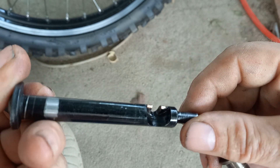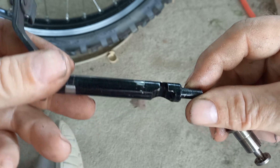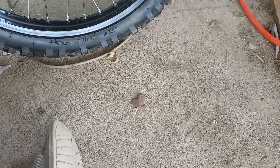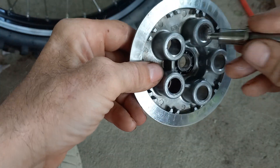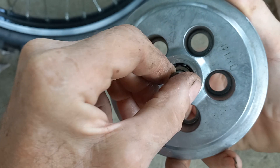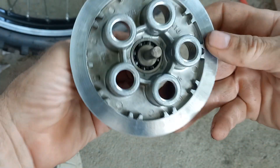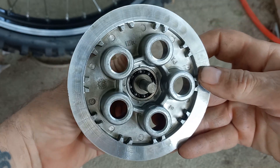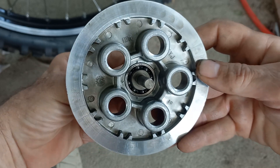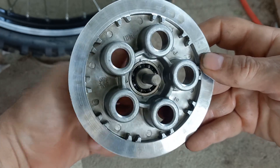See the two shiny bits in there — the only thing I can think of is they are excessively worn. The parts are quite cheap here, so I think it's time we invested in a few more parts for this engine. That fits all right in there, but the shaft is spinning a lot freer than the bearing is actually spinning. Obviously when it's got tension on it and it's being pulled it's going to bind together more, but it's spinning too freely.